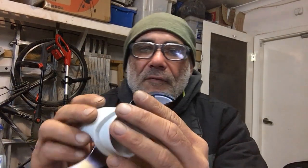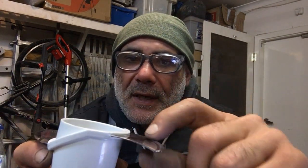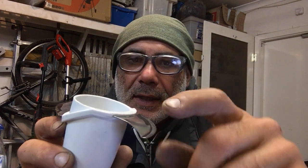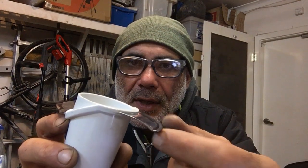Fundamentally, food processor blades aren't like a knife, they're more like a chisel, in that they have a flatter edge. On this one you can see, or hopefully you can see, that this is actually hollow here, and the serrated edges are sitting a little bit prouder of the plate. This means that you can just sharpen this back edge and you'll bring the serrations up. You can only do that so many times before the serrations are gone, and you would need to file them out or buy a new one.